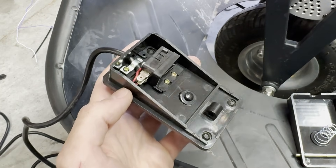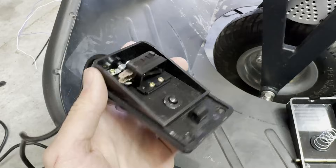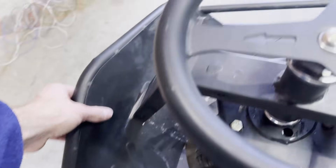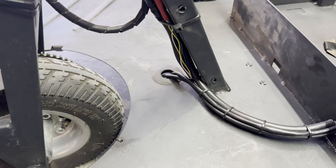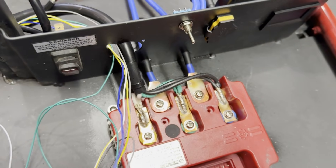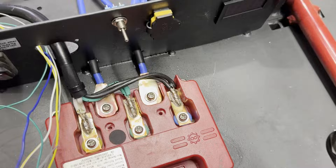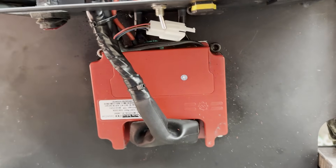The last thing to do before wiring is mounting the foot pedal switch — it's just a micro switch inside, I think it came with my K-Weld. A few holes drilled and bolts threaded later, and it's done. To route the wires, I copied the exact same route that the gas pedal took. Once the wires go up, they meet the motor cables and head into the battery box. The motor cables are soldered to some copper pieces and bolted to the controller since I didn't have any lugs that small.